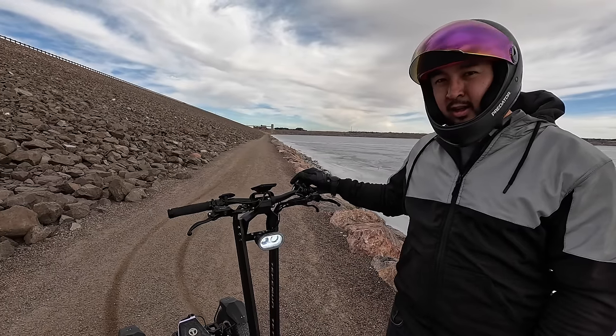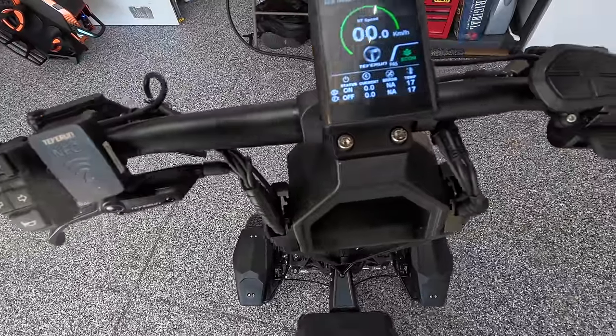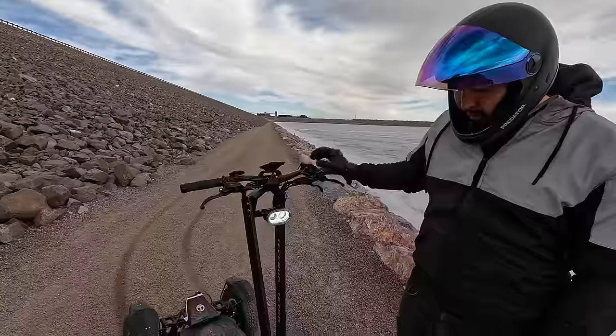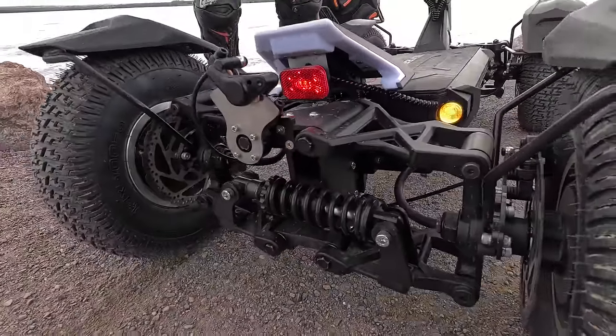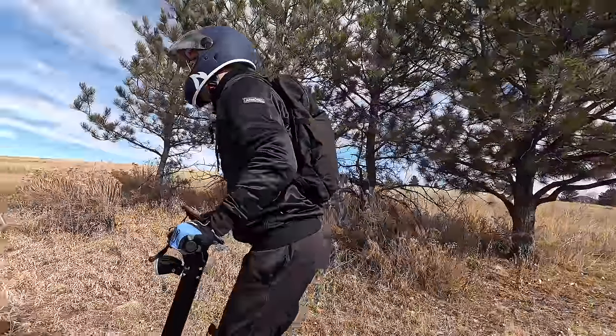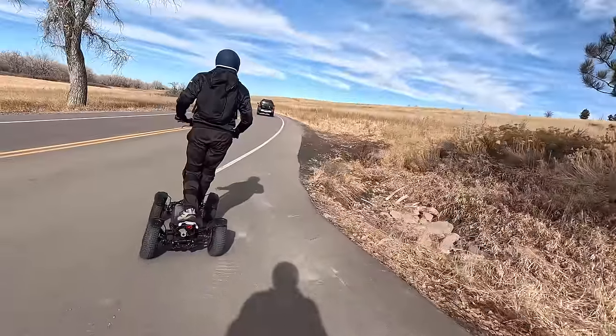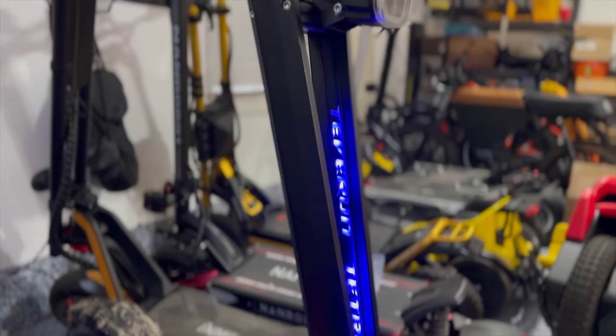This horn is extremely weak — it's almost laughable. Another issue is how you update the scooter: it took over 10 minutes and the display timed out mid-update, leaving me unable to get the update to complete or my phone to connect correctly. They should have been very clear about changing the display sleep setting to keep it on for longer than 10 minutes so your scooter doesn't timeout during an update. The turn signals are also blocked by the chassis — the front chassis blocks the front signals and the rear chassis blocks the rear signals — so when riding with traffic, other motorists can't clearly see your next move.